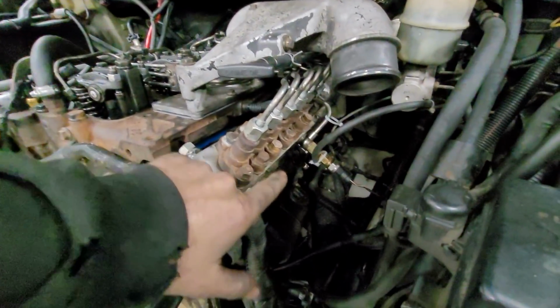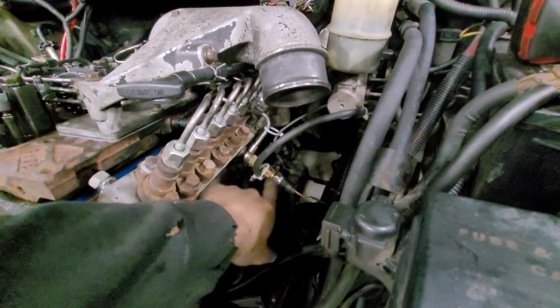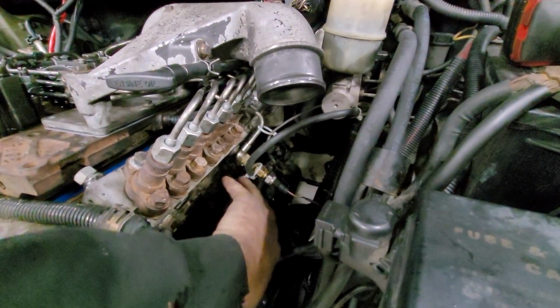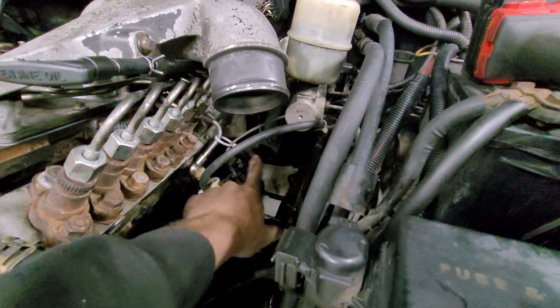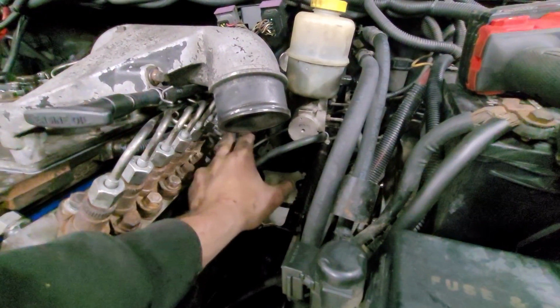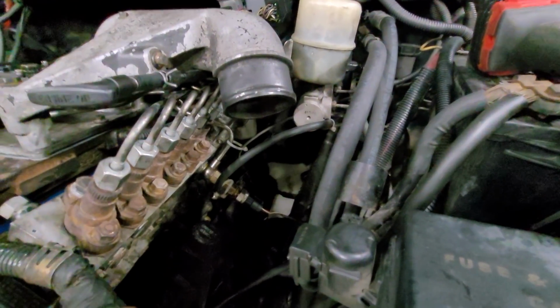All right, here's about where we're at. I got rid of the bracket here with the long, what do you call that, the throttle rod. Cummins wasn't answering their phone, so I was able to just do away with this and make it a lot simpler. So we basically went from the actual throttle pedal back around and through there. That works pretty flawlessly. I'm just trying to figure out the high idle switch.